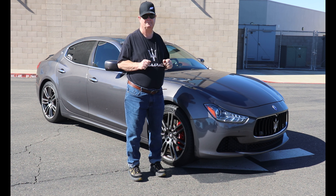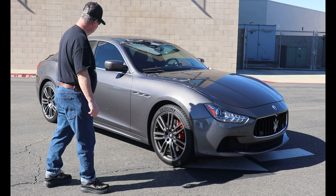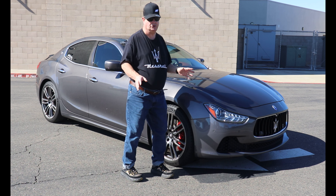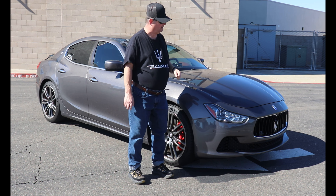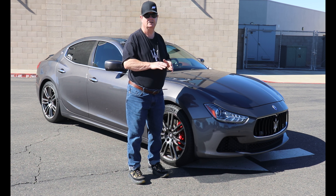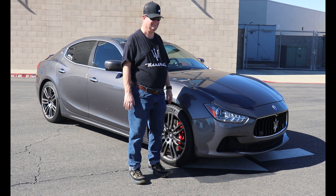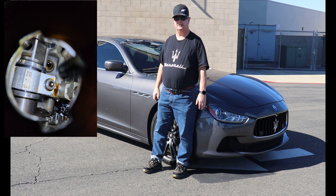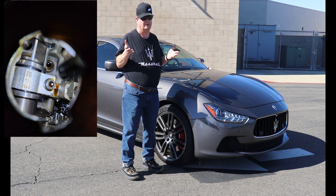Also, when you're looking at the car, I would look at the rotors to make sure there's not excessive wear on them, both front and back, and check out the brake pads. One thing I would do is pull the oil cap off — when you do that you can see part of the valve train in there. What you see will tell you if there have been regular oil changes or not. If you see a lot of varnish and carbon buildup, a lot of crud in there — say no thank you and find another one. But if it's nice and clean like mine is here, that would be a car to consider buying, because a clean valve train tells you that oil changes were done on a regular basis.